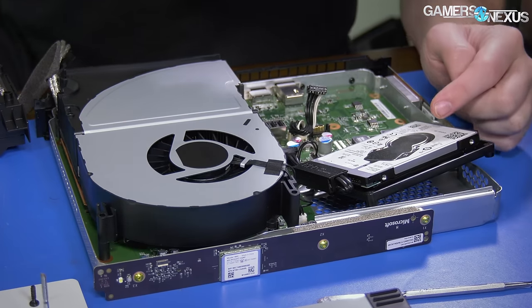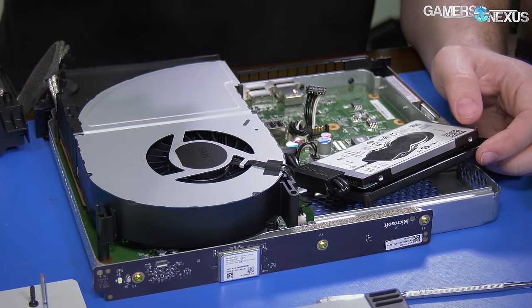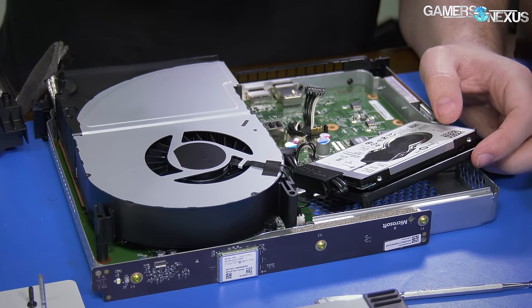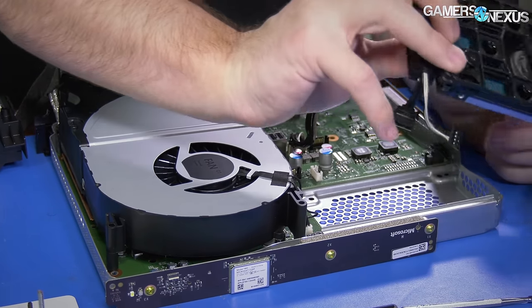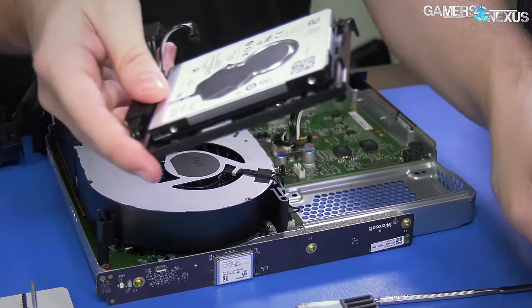We decided to simplify it and just do an external drive. We picked up a Crucial MX500 SSD — a 500GB drive — threw a bunch of games on it, and let it go. The internal drive in the Xbox One X is a Seagate ST1000LM035, which is absolutely a 5400 RPM drive. Some people argued with that when we first opened it, even though the data sheets say 5400 RPM — it is not 7200. Even with the data sheet suggesting a 140 megabyte per second peak transfer rate, it's a physical spinning disk that has to seek to find data, and burst speeds are not the same as sustained speeds.